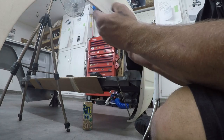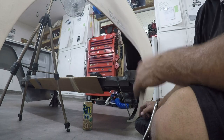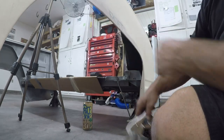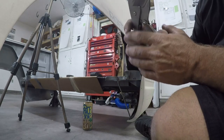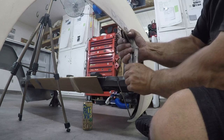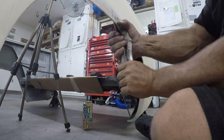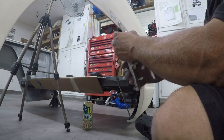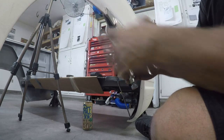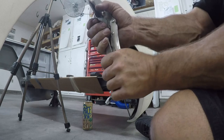Once this is all done and rolled pretty well, I did lose a little bit of my body line contour, but it really isn't that big of a deal because I know how to fix it. Depending on your car you may lose this edge right here. All you need is a standard auto body clamp — set it right here like this, clamp it down, and just bring your body line back in. Very simple to do. I'll still sand this down and do mud work before painting.